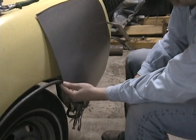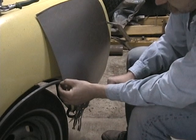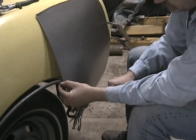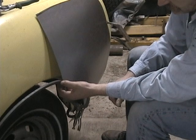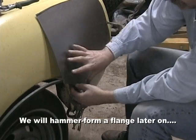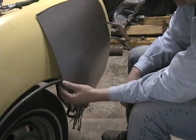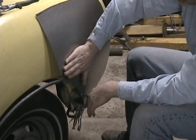You would want to trim this so that the flare panel was in the middle of this piece of square stock. Then when you weld it, you use the MIG welder and basically zap it with a series of tack welds, letting it cool each time, and then another series of tack welds spaced far apart so the panel never feels real warm.